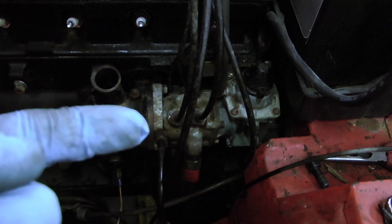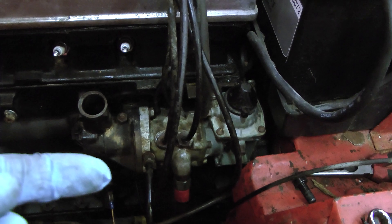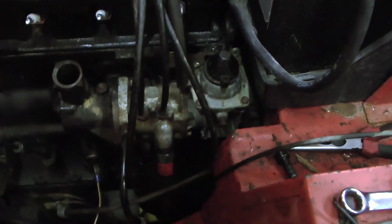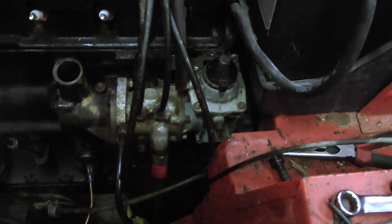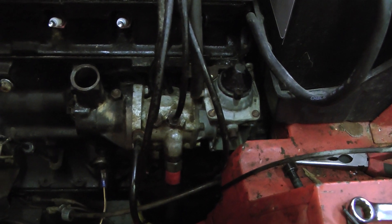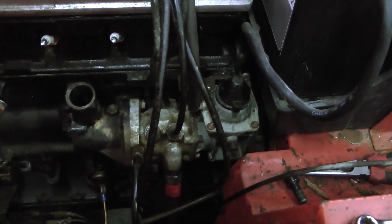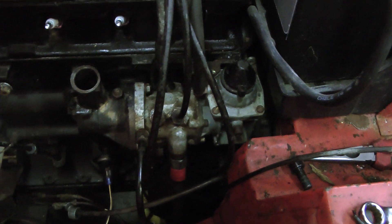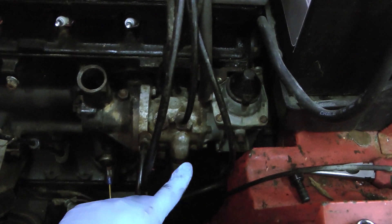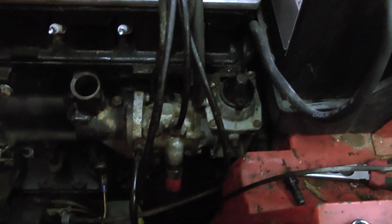Just a quick explanation of how this works, because I thought it was fascinating and I'm probably not going to get an opportunity to do this video again, especially in the workshop because it's nice and quiet. This system is fascinating - it is like a combination of a diesel system and KJet. You have a really high pressure fuel pump in the boot, into a filter, it travels all the way to the front of the car into this unit here. This system operates at 100 psi, so quite a high pressure system.